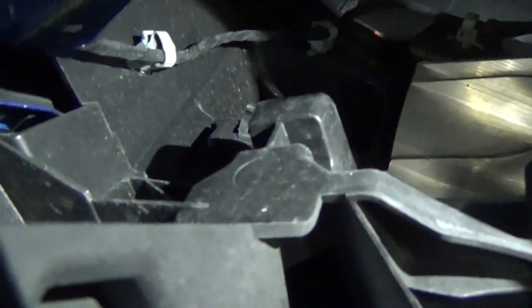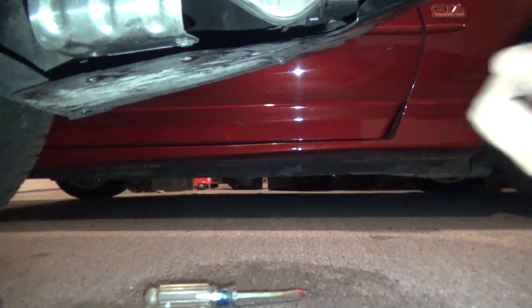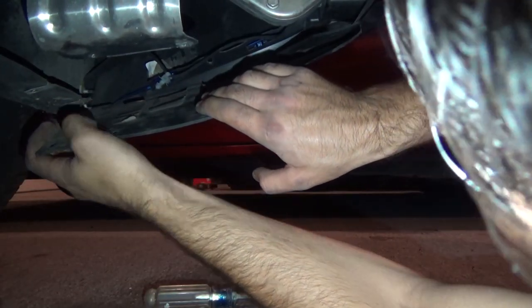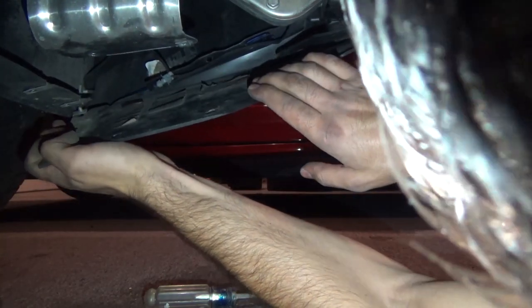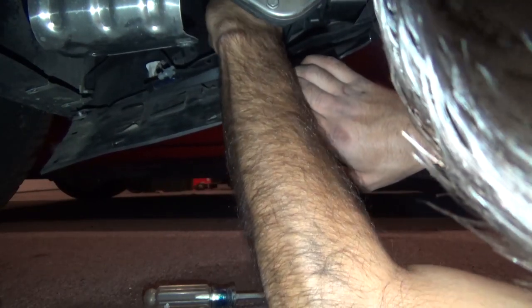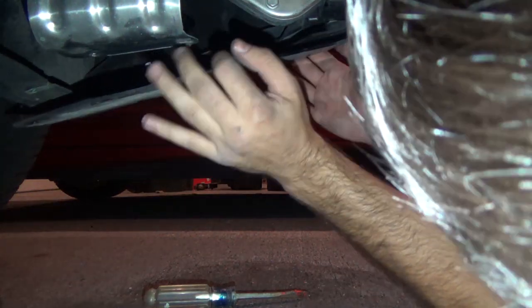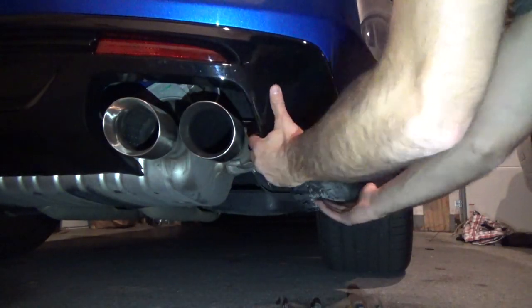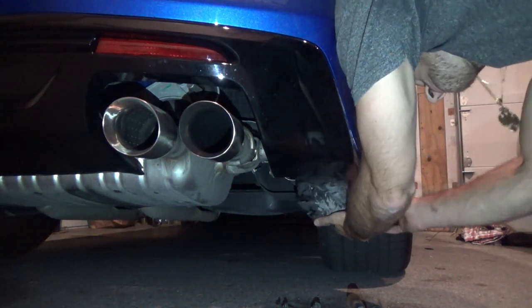Now you want to go back onto the car and look above the exhaust tips. You'll see the little metal clips — you just want to take those off and remove them from the diffuser. Then to remove it, go to the sides and start pulling inward and then push up on the tabs. Then go to the back of your car and pry up from the top, cause that's where the clips are. Just be gentle with it — you don't want to crack it.